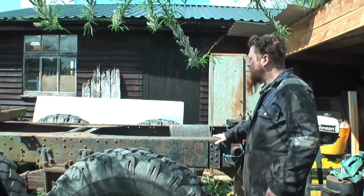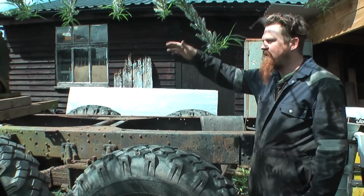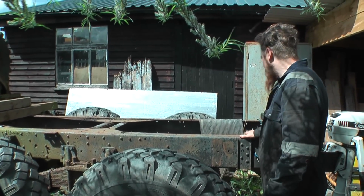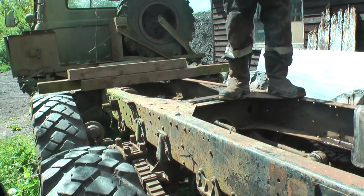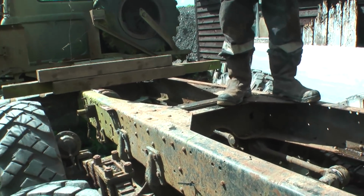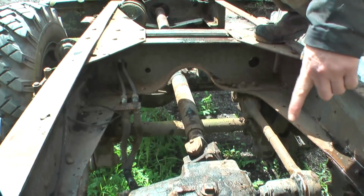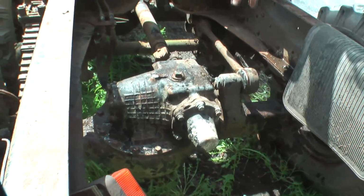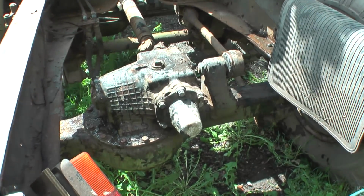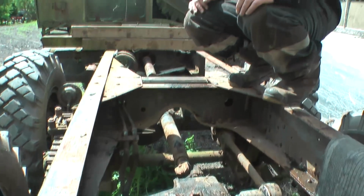The chassis then had the good fortune to at least be covered by a hefty tarp all the time that it sat down there, and it's in really good nick. While we have it exposed, it makes perfect sense to go over it all with a needle gun, get any loose paint off, and then we'll repaint it. Here at the back is another takeoff. Some of these variants of Zills had a powered trailer on the back with a nuclear missile or other exciting things on.